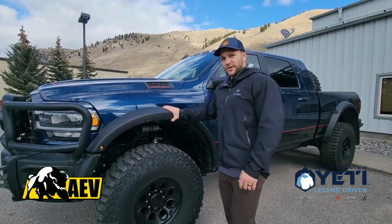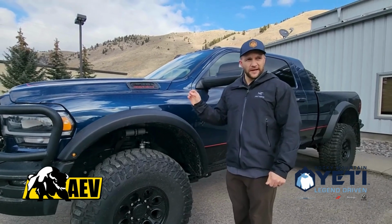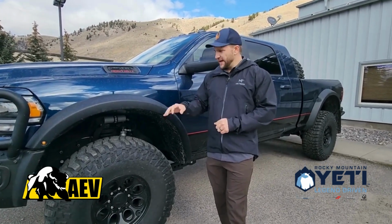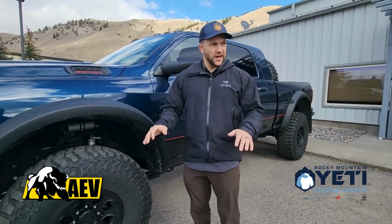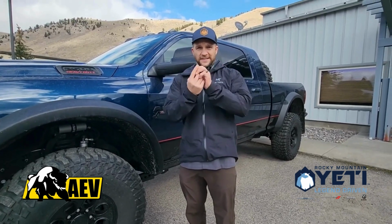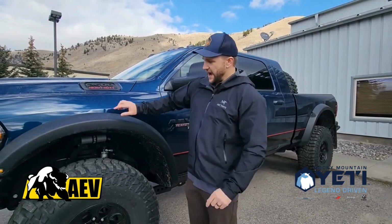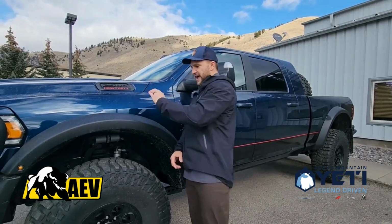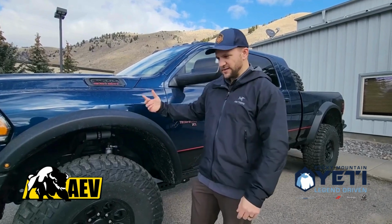These are actually really cool to see if you were to take it off the vehicle. UV stable cross-linked polyethylene. So basically, UV stable means it's not going to fade and dry and crack in the sun. Cross-linked polyethylene is the type of plastic. It's roto-molded, so instead of having a sheet of plastic that's stamped into the shape, there's a nozzle with holes punched in it, and it shoots liquid plastic in 360 degrees to get the shape. They coat it till about a 1/4 inch thick, and the flare is fully boxed. So it's not just C-shaped and bolted to the side. It's enclosed all the way around for strength.